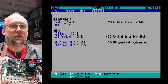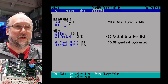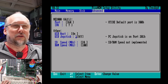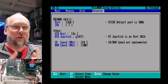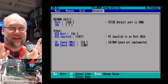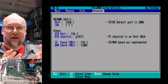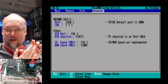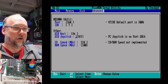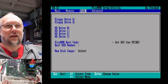There's an advanced tab as well. This allows you to configure the Wi-Fi modem — base IO set to 360, using IRQ 7. To change the IRQ you have to change the jumper on the card itself. There's also the USB host configuration for joystick support and mouse support currently implemented. I don't currently have the USB on-the-go adapter so I can't demonstrate that, but I've seen a video of it working and it seems to work perfectly — a great way to avoid buying an expensive old analog PC joystick.